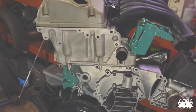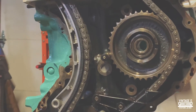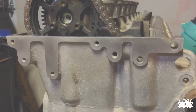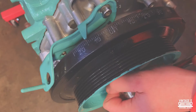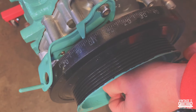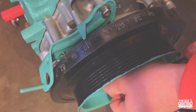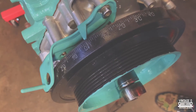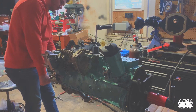The OM 606 is a pretty unique engine as engines go. This is a very light engine and the crank is offset by a full millimeter. Because of that, if you were to set the timing just by top dead center alone, your engine probably wouldn't run very well. If you've ever built one of these engines and did it the way that I did it the first time, leave a comment below and let us know how it actually ran.